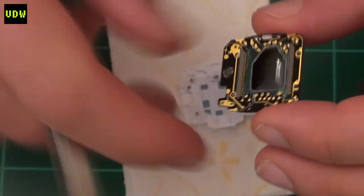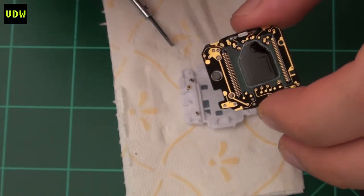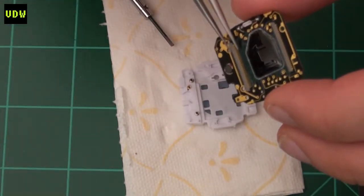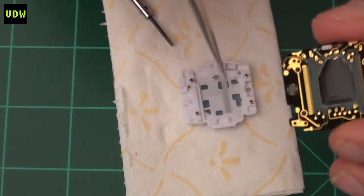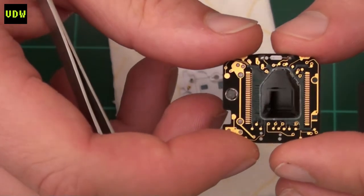This isn't something that happens on all watches, but I've seen LCDs not work because of this. Just gently move the zebra strip — it's not glued into place, you can easily peel it off. And there you have the module stripped down.